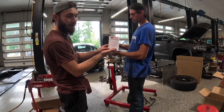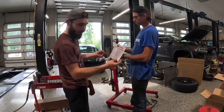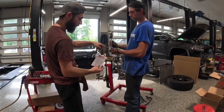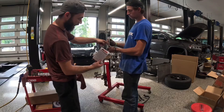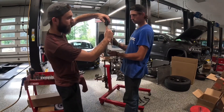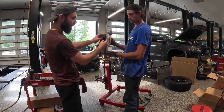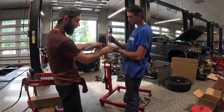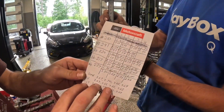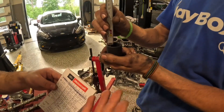Here's our notepad of all the numbers we have. Jack is going to use a socket to demonstrate how we got these numbers. Down here is an average of all the depths of each shim that we measured. The shim is like a socket — the valve comes up, and this goes to the top of the valve. This is your shim depth here. We took an average of 3.67 millimeters.